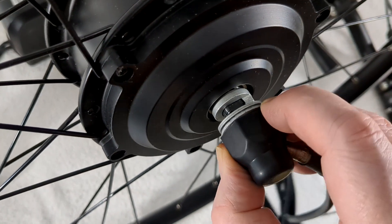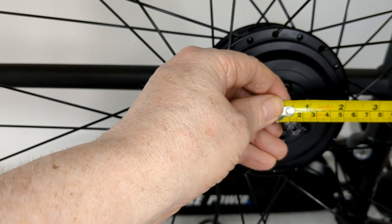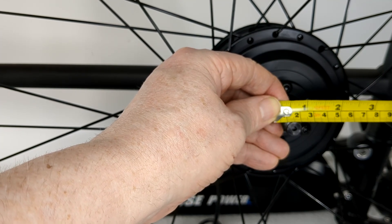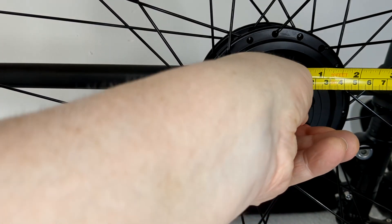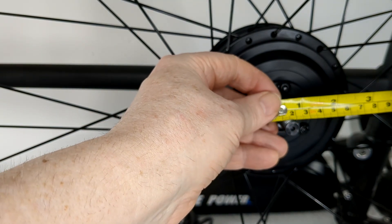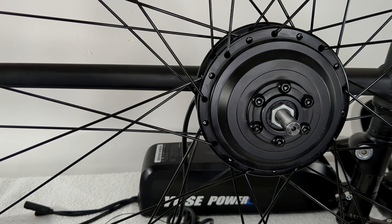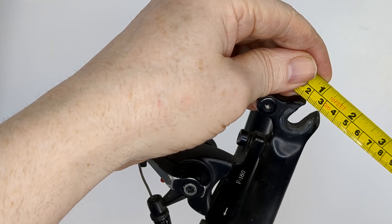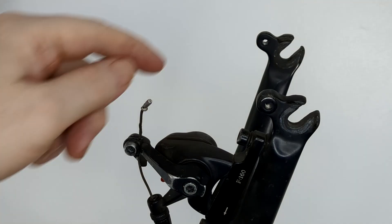There's no way I could get in there without it. I'm taking it to be 10 millimetres — they could say 9 but I think it's 10. There's only a millimetre in the whole thing, but I just can't get it to fit. It's labelled 9 millimetres, so I'm probably going to shave half a millimetre off that side and half a millimetre off that side, same over there.